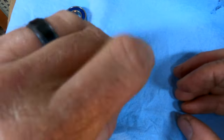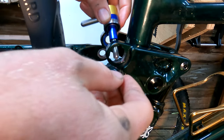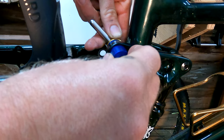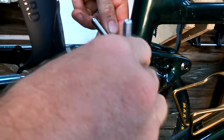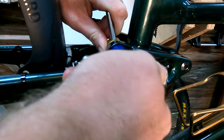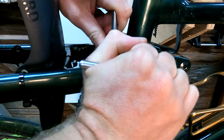Now we switch to the blue die — blue die, handle, rod, and the new bearing. Slides on like that, goes into there, and the other half of the die slides on. If you want to make this a little easier, I was talking before about using temperature to your advantage: you can stick that new bearing in the freezer for a bit to get it cold and shrink it down. But with this awesome bearing press, it's going in super easy. Put her in until she's nice and snug. Beautiful — that is pretty slick.